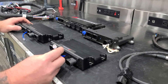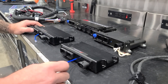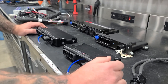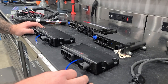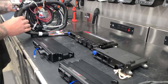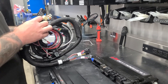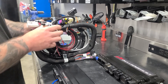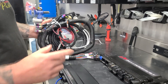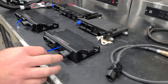The Terminator X has an onboard one-bar MAP sensor. I don't use it because it's a pain to run a hose into the car, but if that's something important to you, you can use it. The harness is already populated for a MAP sensor, so you can also plug an external MAP sensor in under the hood with this, or just use the one-bar MAP that's already built in.